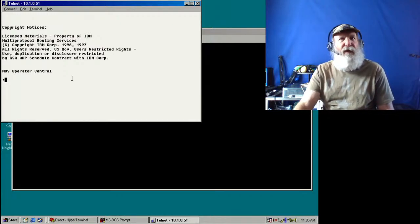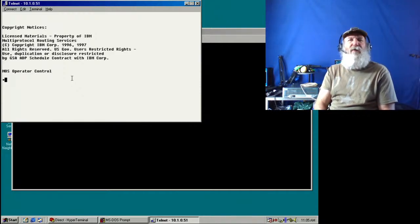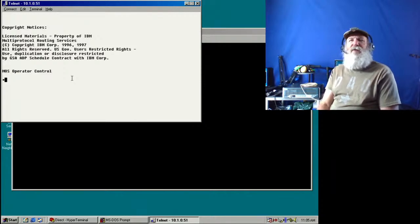And the nice thing here too is I can hit the Ethernet interface from my modern system. I can go through and have screens showing the configuration of the 2210 to be able to try some things and to do the basic things like pings before I'm able to access the outside world. Now, the token ring side, that gateway address and things like that, I've got the token ring network set up correctly for, and the DHCP server passing that gateway address to the machines that are getting the IP address over the network.